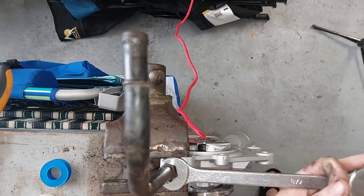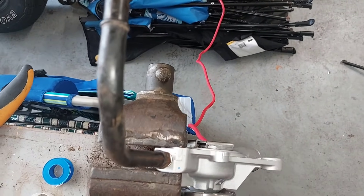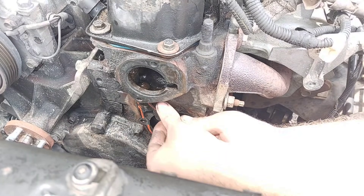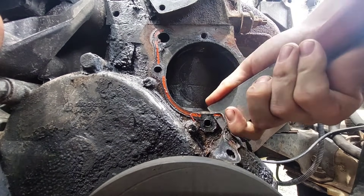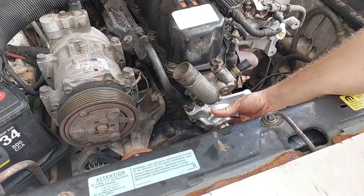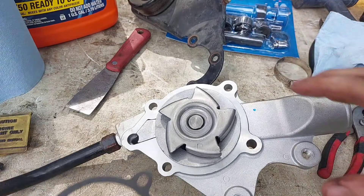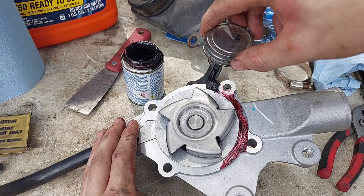Tighten the pipe down until it's pointed perpendicular to the rest of the water pump — we can fine-tune it on the engine. Back on the engine, it's time to scrape off the old gasket material on the block. Although tedious, this is very necessary — spend some time here and make sure to get that surface clean or it'll leak. Quickly test-fit the water pump to make sure the heater pipe is angled correctly, then coat the gasket surface with sealer. I've never gotten a paper gasket to seal a coolant passage without this stuff — maybe skill issue — but make sure not to get it anywhere else, as it's very sticky.